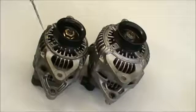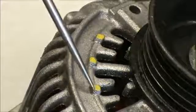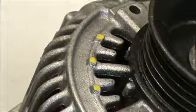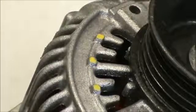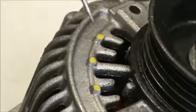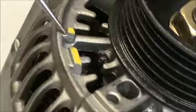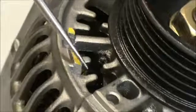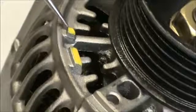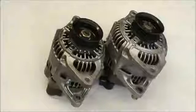If you look at this area right here, you'll see casting marks. The large frame has three identification tabs — three small square tabs that we've highlighted in yellow — that makes it the large frame. So if you're ordering a Denso cranked up kit, you have to specify that you're ordering the large frame if you have those three tabs. The small frame has a long and a short tab, and that's the easiest way to tell the difference between the large frame and the small frame.